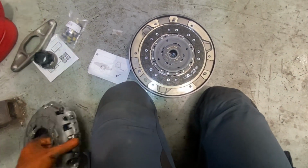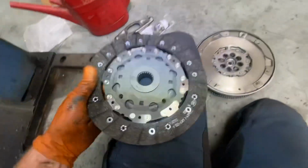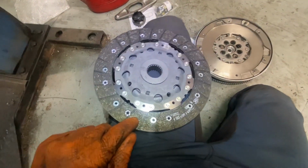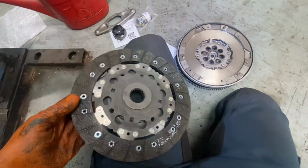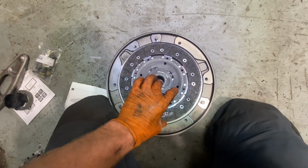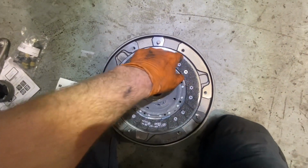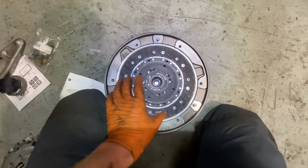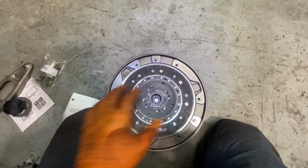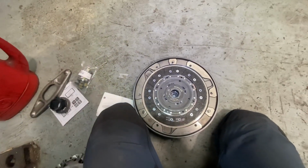I'm going to use a clutch alignment tool today, but what can be done, if someone wanted, it's only a fast pointer for a DIYer: get super glue and put a little blob here, a blob here, and maybe a blob there. So like 3 little dots of glue. Once your dual mass flywheel is bolted on, then sit it into a center point position. Get it as central as you can. So just look at the area around the edge and make sure it's lined up as it should be. You can also use the center point in here as a reference just to make sure it's in the right place. Once that glue dries, then you can sit on your pressure plate and squeeze it together.